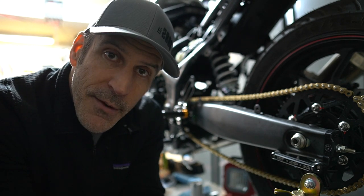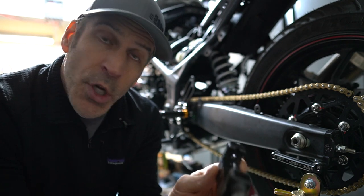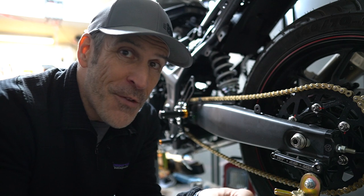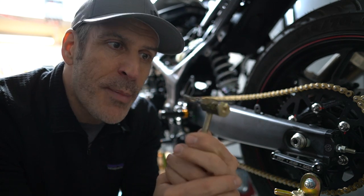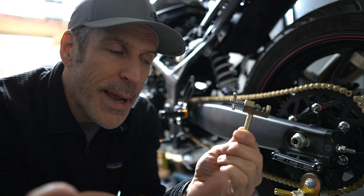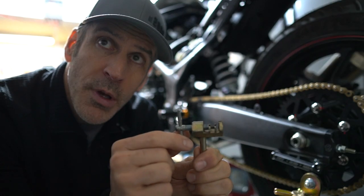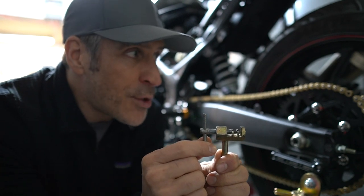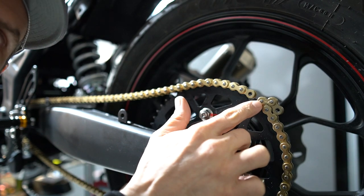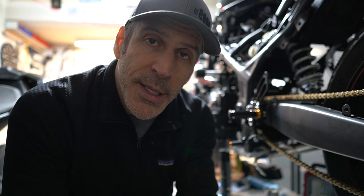With COVID I'm still waiting for different tools and parts to come in, so I don't have the new 415-specific chain breaking tool I ordered. What I'm going to do instead is use a regular mountain bike chain tool, which allows me to break this specific chain. However, it's not solid enough on its own, so I'll first take my Dremel tool and grind off the mushroom part at the top of the rivet, then use the bicycle chain tool to push the pin out.